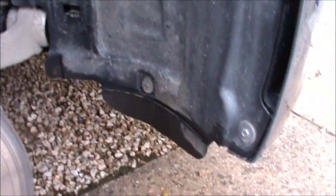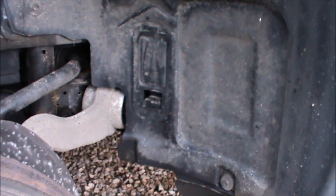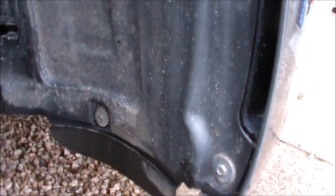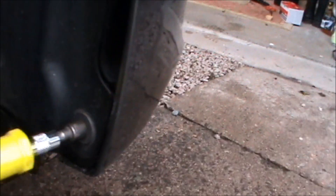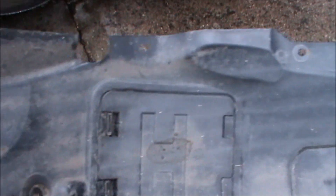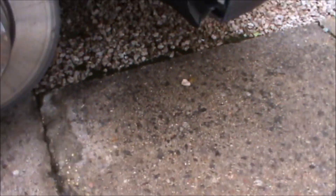Back to the job in hand — you can see these are the screws that hold on the wheel arch. There's actually one missing up here and some down the other side. I took these hatches off previously: one of the top ones gives access to the main headlight, and there's a small one down here for the fog lamp. The screws all come off with an 8mm hex and were all quite loose, which probably explains why there's one missing.